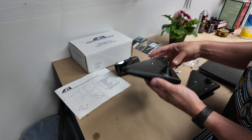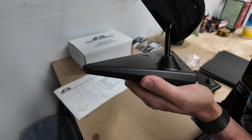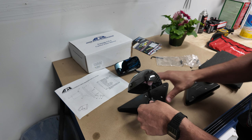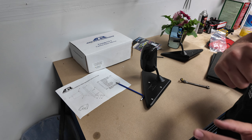This plate will be on the passenger side, so we'll go ahead and take our passenger side mirror and thread it on. I can't get it too tight by hand because that ball in there just wants to spin, but the stud has got some flat spots so we'll put a wrench on there — looks like a 5/16 wrench will do the trick. We've also got six M5 screws here which we'll be using to mount the base plates to the car.